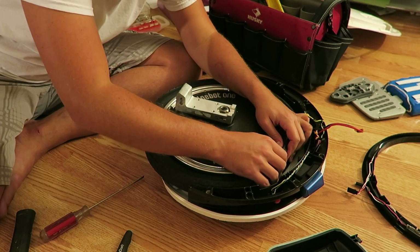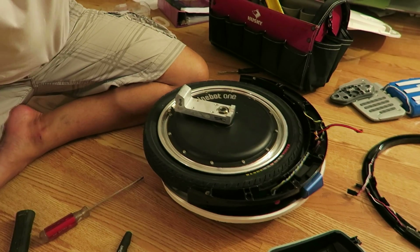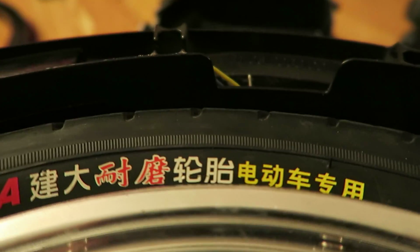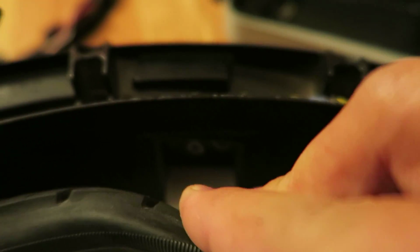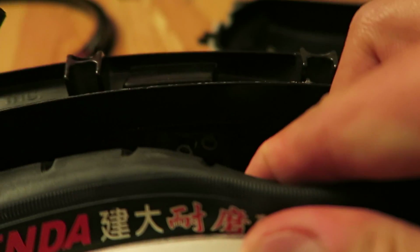I have all the air out of my tire. This gives me plenty of wiggle room. I'm going to take the camera off the mount for a second and show you what we're working with. Okay. All right. This is what we've got. So up here, the camera's going to pick that up. Tucked up in that little cavity, there's 3 screws that basically look similar to one of these guys. It's got a bigger opening, it's going to require a different Allen key. But from what it looks like, these 3 screws directly ratchet into this guy.